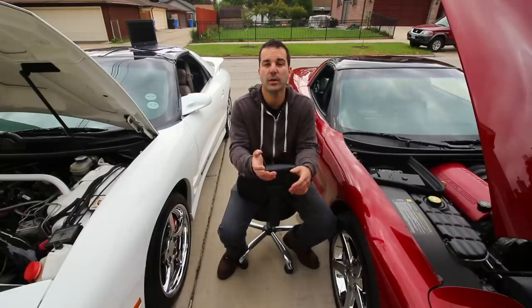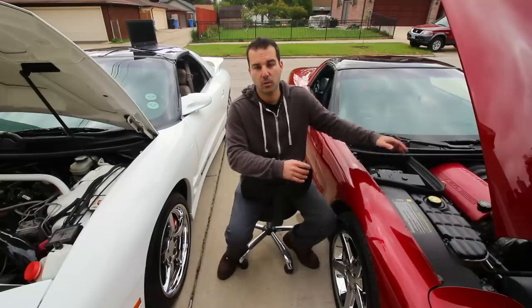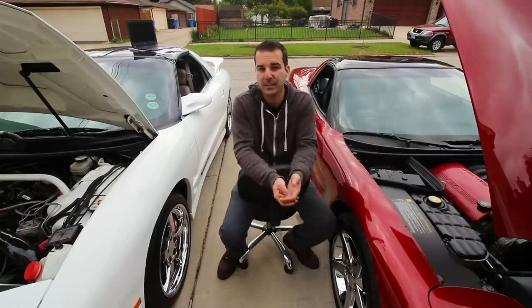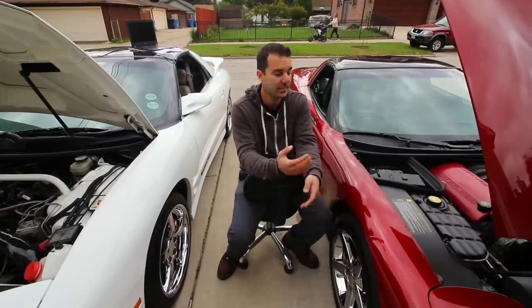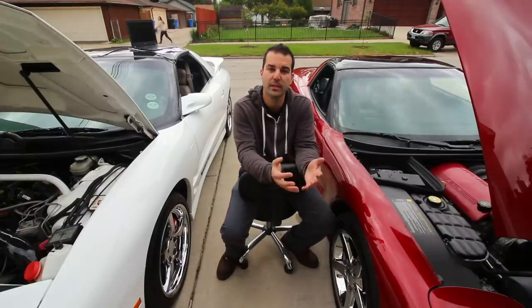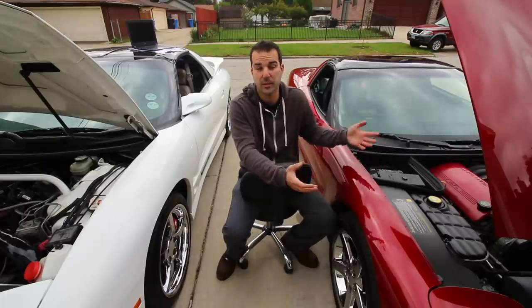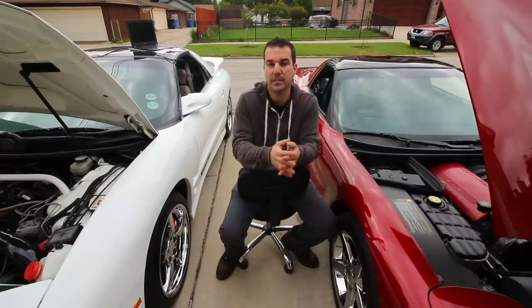So in our case here, we can't just simply rip off the Holden LS computer. I mean, we could, but technically it's not legal to activate full-blown lean burn here in the United States, and we want to keep this thing emissions compliant. We don't want to mess around with the exhaust. And if we go too crazy with AFR, we do have to monitor cylinder temperature as well. I mean, you could literally melt your engine down if it's not designed specifically for lean burn mode.